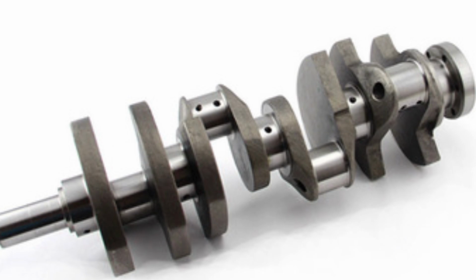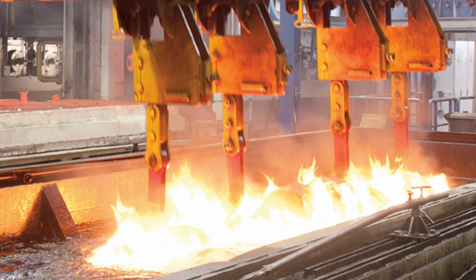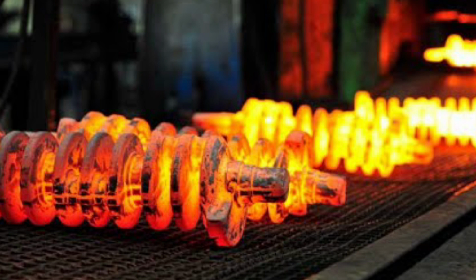After a crank is rough machined, it's baked to roughly over 1,000 degrees F, then it's rapidly cooled or quenched in water, oil, or some type of polymer quenchant. Now the crank is stronger, but it has little ductility or impact resistance, so it has to be stress relieved, or tempered, and that involves heating the crank again to a temperature roughly around 600 or 700 degrees F. Then the cooling process is controlled, and according to the properties of the steel, the cooling process will determine the final outcome of that heat treat.